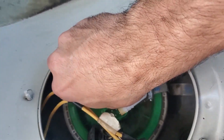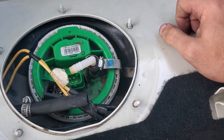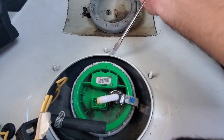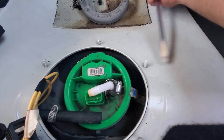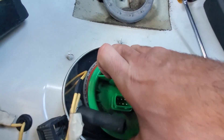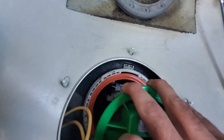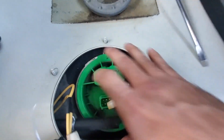If I remember, it just lifts up and there's a seal, but probably going to need two hands for that. So get a flathead under here, you can just lift it up — you can also pull on the edge just a little bit and it should hopefully pop up. You can see down in there — that's our fuel assembly — so you need to pull the whole thing out and start taking it apart.